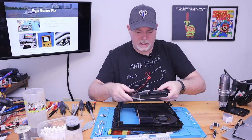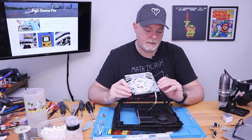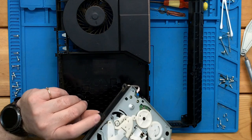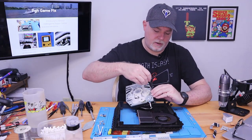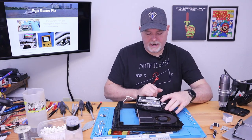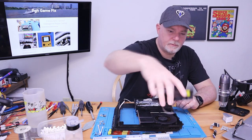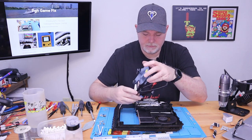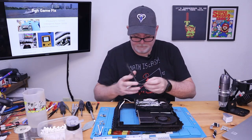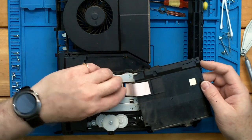Now, just a moment ago, I said that I'm knocking gears loose, and what it was is once this cover's off, the manual eject screw can fall out with the spring. And that allows you to open the top cover and put a screwdriver in there, push down on it and turn it, and it'll turn the rollers. So anyway, if that falls out, it just goes right back down into this hole here, and the spring goes on top. So from here, we can put our covers back on. Yeah, we might want to get a little closer to that to make sure our ribbon's down in there flat. Bail goes up. Ribbon goes in. Bail goes down. Pretty straightforward.